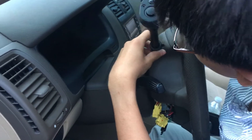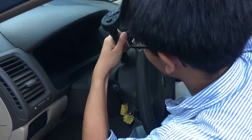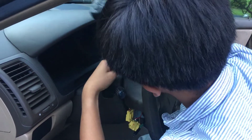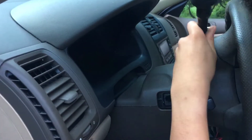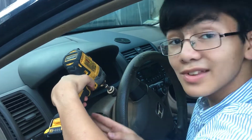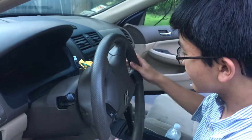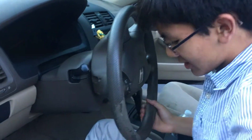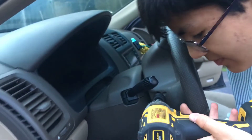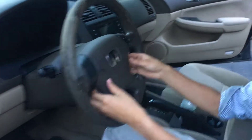Sorry about that. Now I can take it out. It's a bit hard to do at this angle. You can tell when it's not locked on when the ratchet's not ratcheting. If you have a power tool like a cordless impact driver, it's certainly going to make the job easier. Now you're going to turn the wheel all the way to the other side. We've already done that — now you want to do the same exact thing but on this side with the other screw. Make sure it's angled correctly, inserted, and spinning the right way. Once the screws are out, it's really easy.